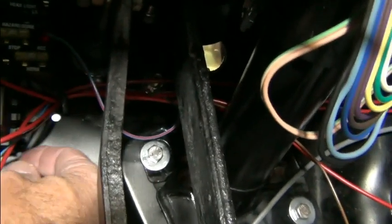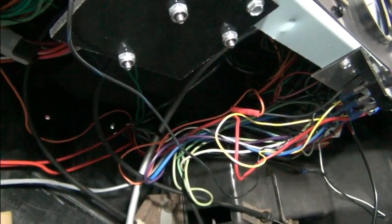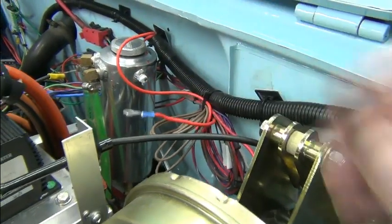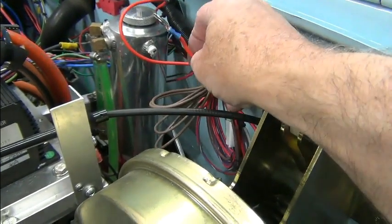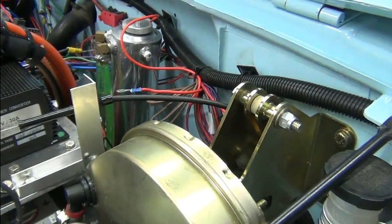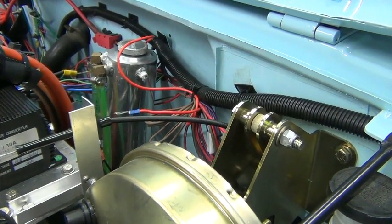The power wire is going over and through the firewall. I traced it and this is the issue: we don't have power hooked up. The relay coil is being activated, but the power going to the contacts of the relay is not connected — so the relay coil activates but there's no power to the contacts to actually operate the windows. We'll connect that, hook up that one ground, and rerun the harness.